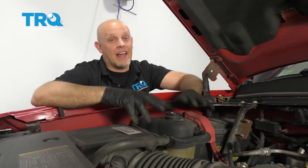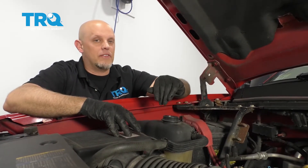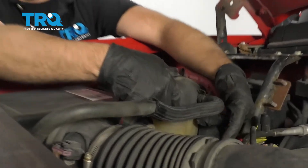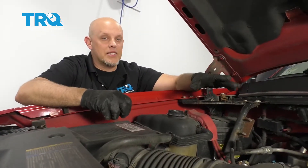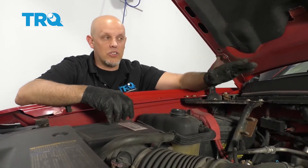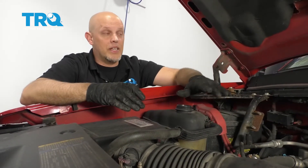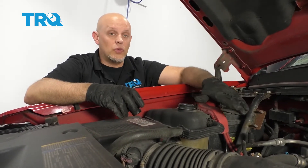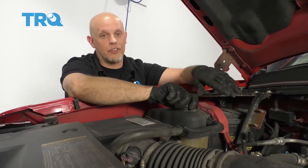At this point we can add coolant. Make sure you check your owner's manual to add the correct coolant — a 50-50 mix. Use a funnel and fill it up until you find the fill line on the reservoir. Then run the vehicle for about 10 minutes with the heat about halfway on, continually checking to make sure the engine is not overheating and checking the level. After it's run about 10 minutes and you have heat, shut the vehicle down, adjust the level, let the engine cool down, and put the cap back on. Road test the vehicle and double-check after you're done.